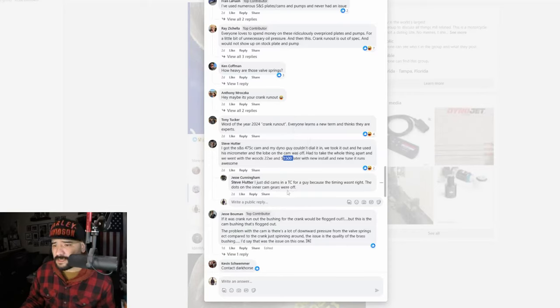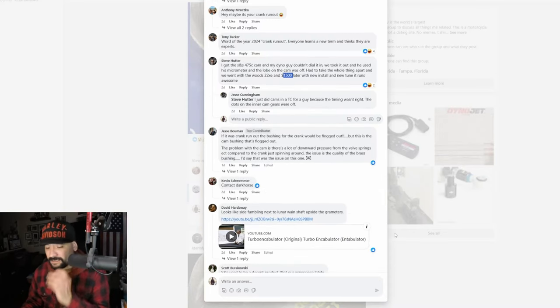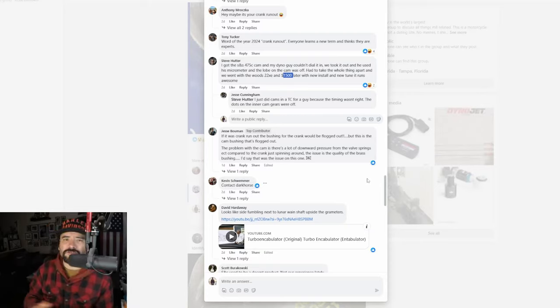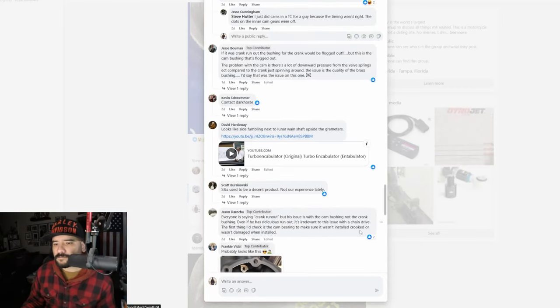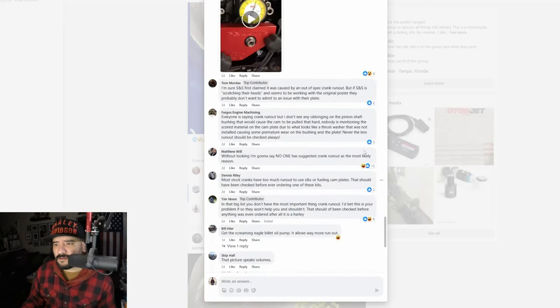I just did a cam in a twin cam for a guy because his timing wasn't right. The dots on the inner cam gears were off. But you know what? That's nuts. But wait a minute. He said he dropped in a new cam, right? In the description, he said he dropped in a different 475 cam. Was it a 475? What else do we have here? So yeah, we have crank runout.